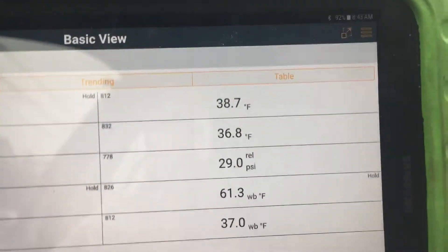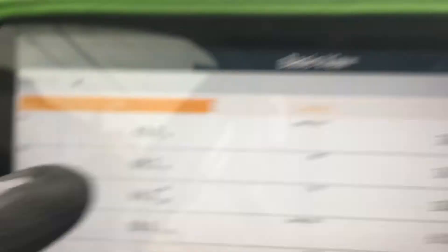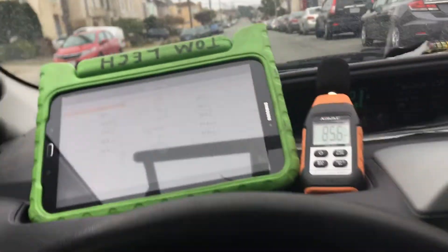So not sure how accurate that is. The temperature out of the dash right now is 38.7 degrees coming out of the dash at this temperature sensor. Then 68 degrees is another sensor located inside — that's actually my inside cabin. That's the fresh air intake where I took out the glove box; there's another one of these sensors up inside there. Right now that is 69.3 degrees — that is the temperature inside my car.